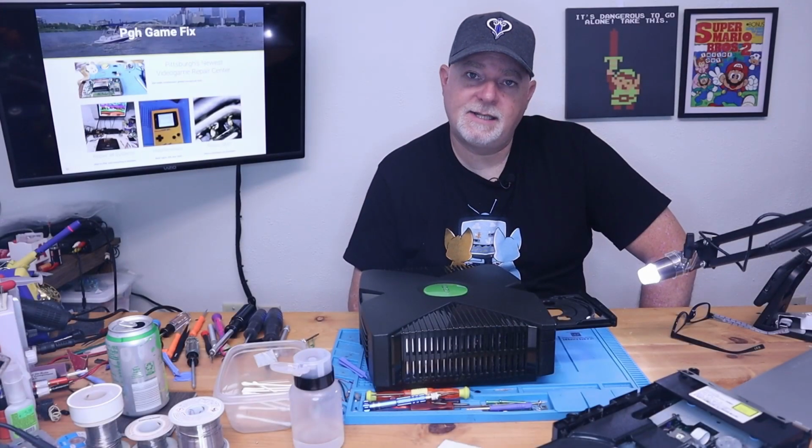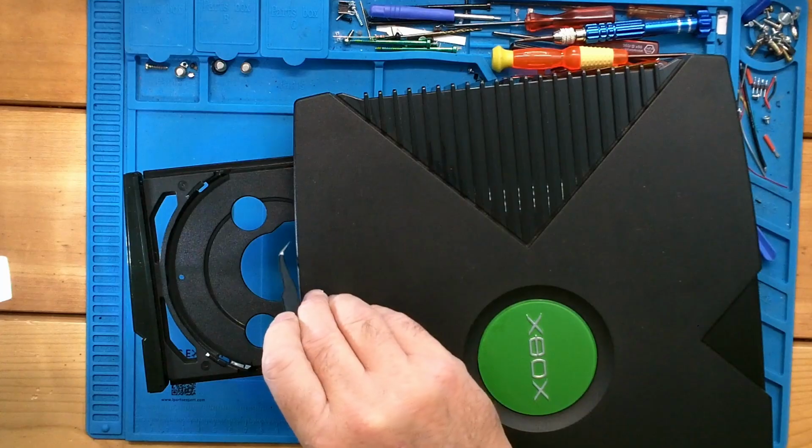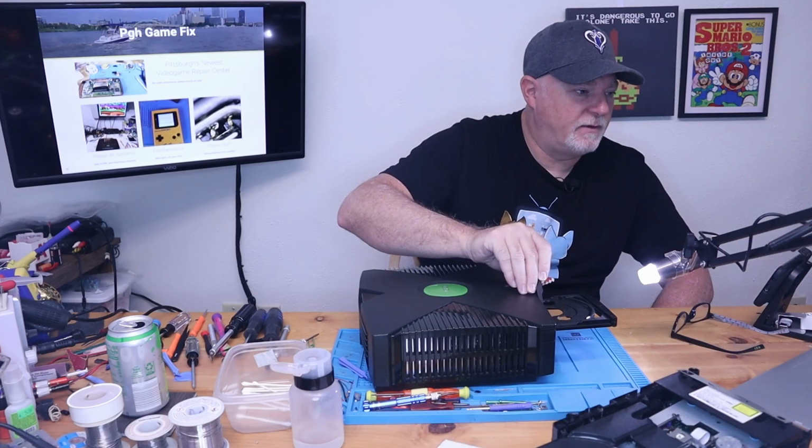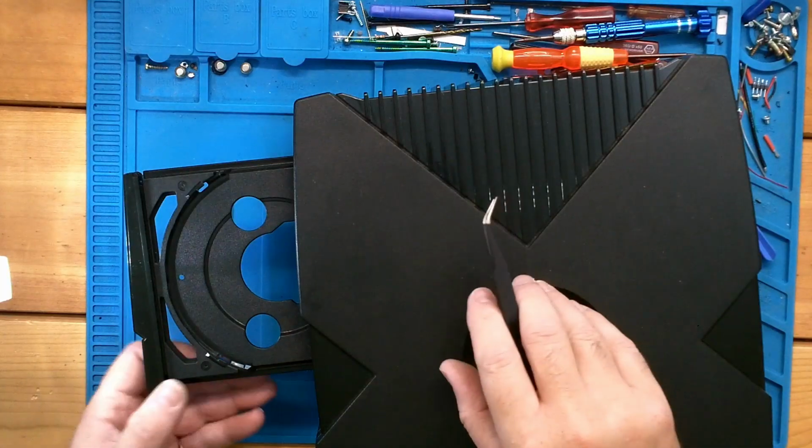All right, I think we've got a setup where we can see the whole thing, and it's kind of peeking right into the drive. And from here, where we're at is right down into the bay right here. And you can see this is one of the short belt versions. There's our little drive. This is the motor. The small pulley is the drive motor. And the bigger pulley is our driven pulley, which is what actually ejects this tray. I'm gonna pull this tray out a little bit more, make some more room.